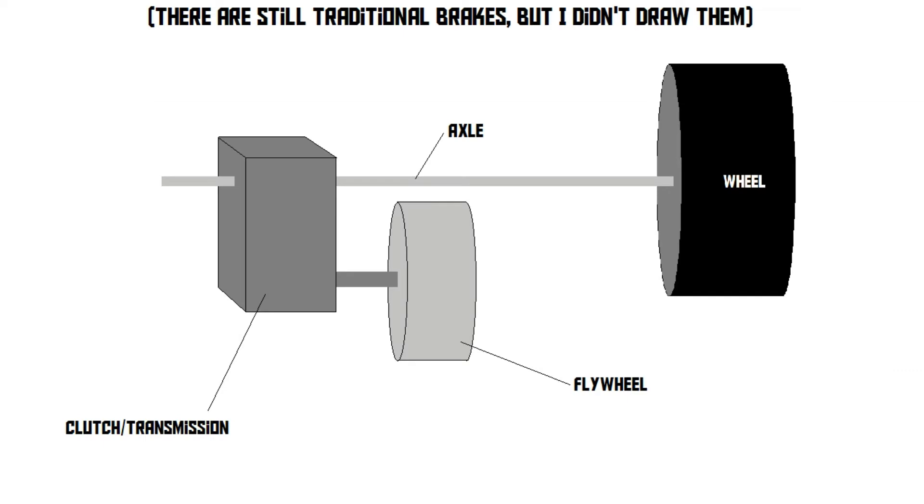Here's a schematic drawing. A flywheel is positioned right next to one of the axles, and there is a clutch between the flywheel and the axle. Normally when the car is driving, the flywheel isn't connected to the axle, since it would otherwise slow down the car. When the driver starts braking, however, the flywheel connects to the axle, helping the conventional brakes slow down the car. The flywheel then starts rotating at a very high speed. After it has started spinning, it disconnects from the axle again. Then, when the car needs to accelerate — maybe the driver wants to overtake someone — the spinning flywheel can be reconnected to the axle to give the car an extra boost.